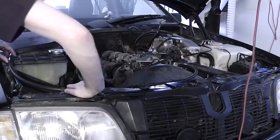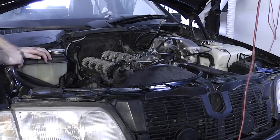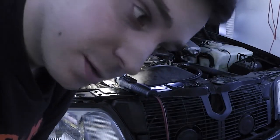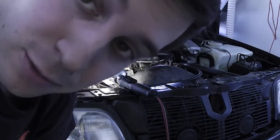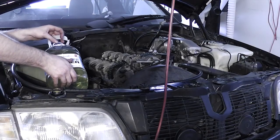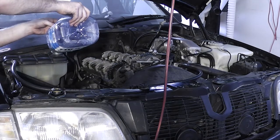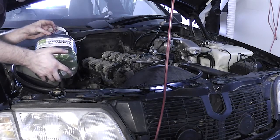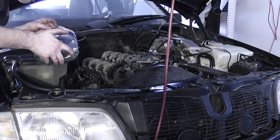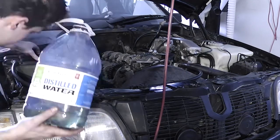I made myself a new thermostat to expansion tank hose using some 8mm heater hose, which is the international way of saying five-sixteenths of an inch. Before you forget, reconnect your alternator — I bolted it back up to the engine and then proceeded to do everything else, and I would have been in for a surprise if my alternator was still disconnected. Once you've got that done, time to fill everything up with coolant. I'd love to have a vacuum cooling system filling tool, but since my budget is non-existent, I'd advise a different method to bleed the cooling system of air — more on that later. Your thermostat may have a bleed screw, but mine didn't; it just has a blank spot where a bleed screw could have been.